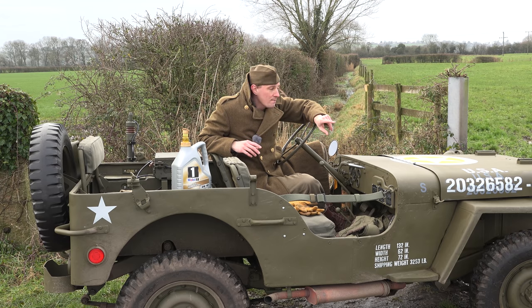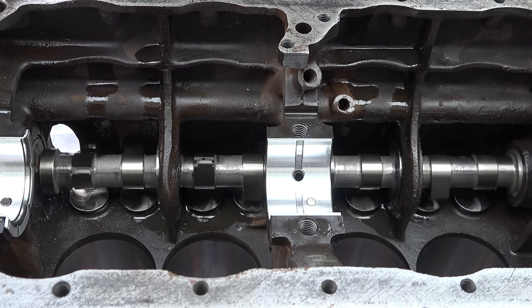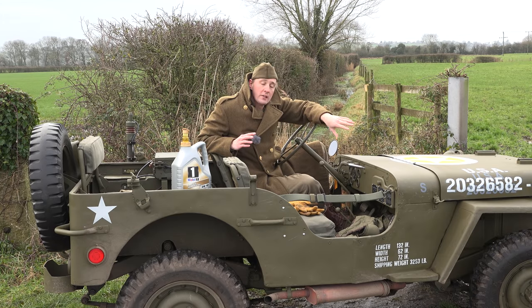But is that such a good thing for this old engine? This is what I've had to look at and form an opinion about — and I'm going to let you form your own. That fully synthetic modern oil is perhaps a little bit too good for this old engine. Some of you will be going, 'of course it is, Matt' — but it's not entirely how you might think. That oil is doing exactly what it's supposed to do: protecting the engine, protecting those tappets. This engine has flat tappets, and you need ZDDP — the zinc — to protect those tappets. Those tappets are extremely high wear, high shear; the forces are massive. Normal oil without ZDDP or other additives just means those tappets get wiped out, the cam gets damaged, and your engine doesn't run as well.